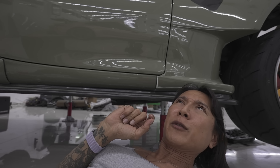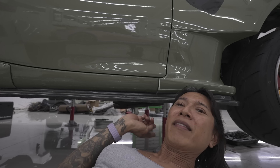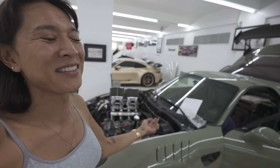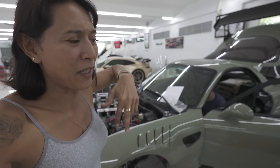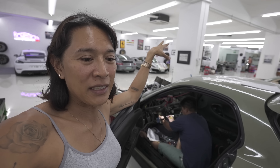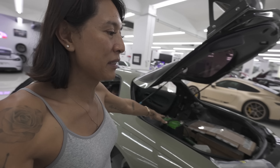I inverted the screw. It's like 9 in the evening, so tired, and I haven't been doing any updates because we've been working on two cars — this car, the RX-7, and the M4 back there. We've had some issues and we're not going to be able to finish the car here at the farm. We've got to bring it down to Manila. We have major issues with the engine being off-center and the headers hitting the chassis and the intake also hitting the strut tower. The executive decision is to get the car back on the ground, send it down to Manila, redo the exhaust because it's also sticking past underneath the chassis — it's too low — and there's no way we're going to be able to run that.